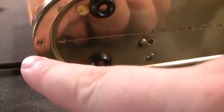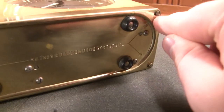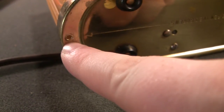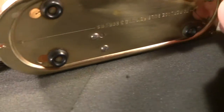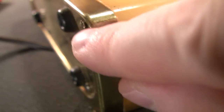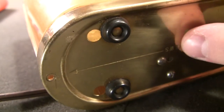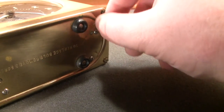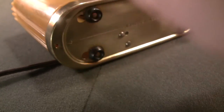I think I just solved the riddle of why there's a missing screw here. I just noticed that I tried using one of these screws in this hole and they just wouldn't gain any grip — probably because the threads have been stripped. And I just thought of something: that's probably why, even when the screws are tight, they don't screw in all the way and still stick out some. Whoever serviced this thing probably thought the screws had to go in more, kept trying to tighten it, ended up stripping the threads, and then lost the screw because it wouldn't stay in place.